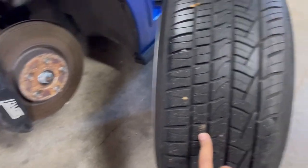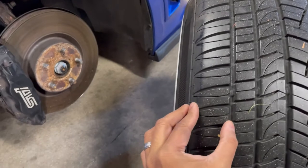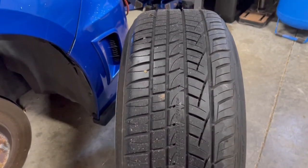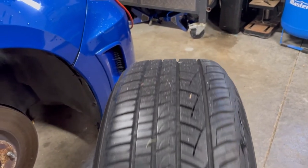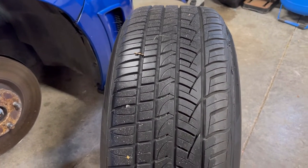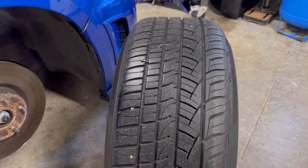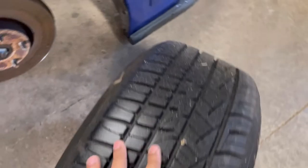You can see I just used the OEM jack. Look at the tire — that's why it's important to get an alignment. You can see a little bit of additional wear on one side versus the other, but honestly considering this is my daily and I don't drive crazy, the tread is even for the most part. More reason to say it's not camber that wears your tires — it's your toe. As long as you get your toe fixed, your camber is going to be good.